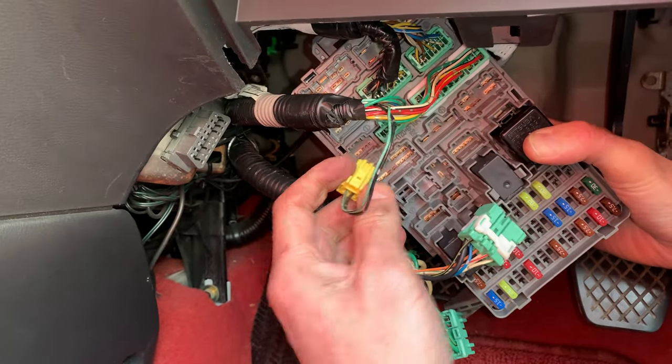After a fair amount of struggling I finally got all the clips back in. There's no specific sequence you need to follow, but there is a sequence that makes it easier — a lot of the wires are actually pretty short so there's not enough room to take them over or under other wires. If I'm doing this again I'll pay close attention to how the wires are routed. Got all the clips back in and connected up, now tightening the negative terminal on the battery and I'm going to fire the car up and see if we've solved the problem.